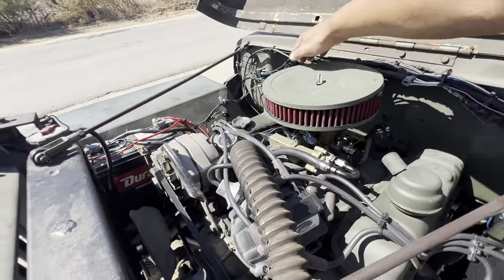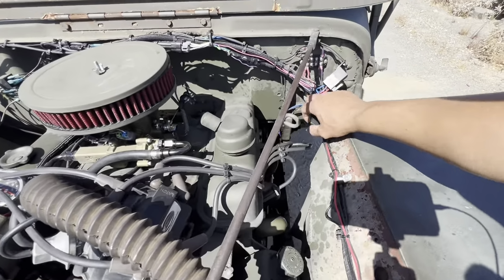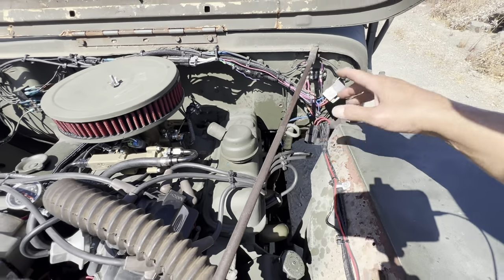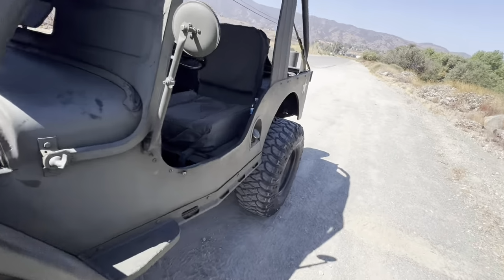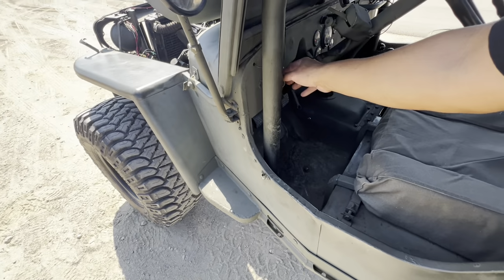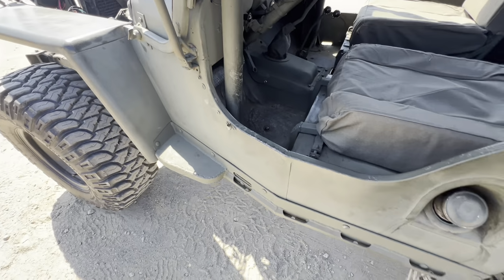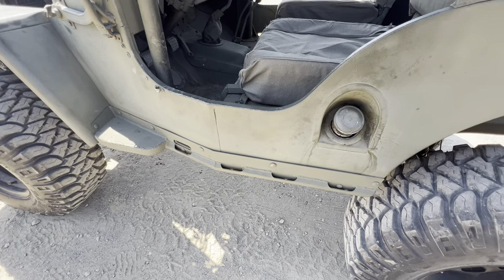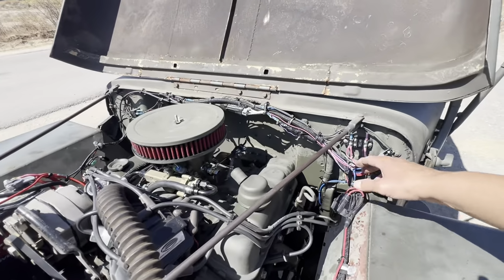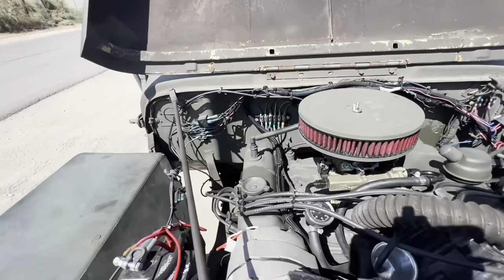Yeah, the wiring is in the directions. I just put my stuff up here. Pink goes to key powered. The blue is your fuel pump. Now, the other issue that I was afraid of, that I've seen on a couple other YouTube channels, is the fuel pump is really loud, and that was kind of a deterrent. But if you can hear it, hopefully no cars come by. The one that comes with it is not that loud. As far as the wiring goes, there are other YouTube videos directly from Holley, and they have those out there on how to do it all.